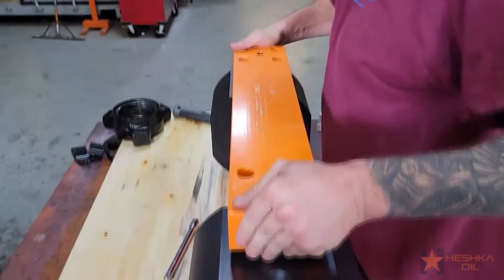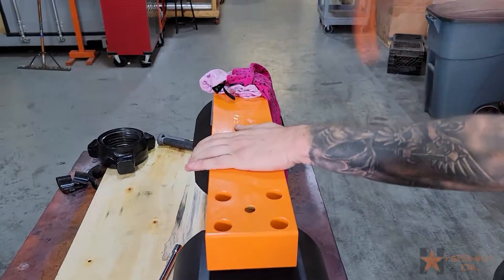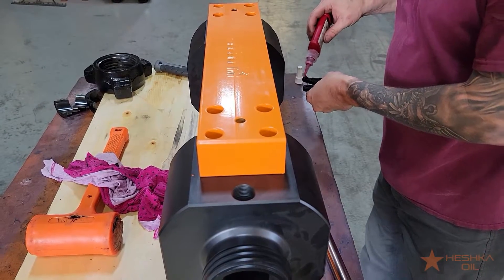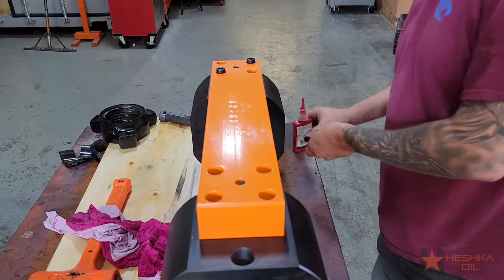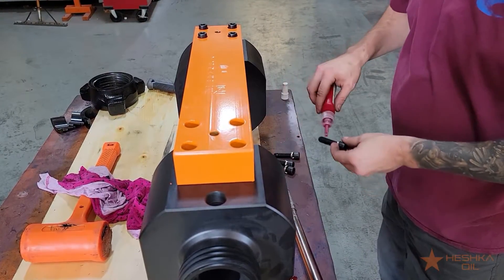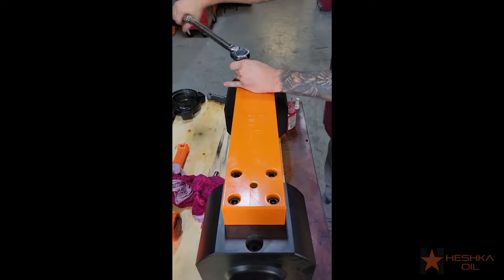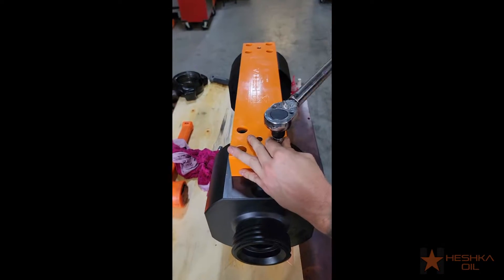To make this easier, we rotate the assembly onto the side plate as you can see in the video. Once the side plate is on the dowel pins, you can lightly hammer until it's flush with the yoke. Then install the remaining eight side plate bolts hand tight, remembering your lock washer and a small amount of lock tight. Once all the bolts are in both side plates, it's usually a good idea to give it a once over with the torque wrench. We normally use a setting of about 30 foot-pounds.